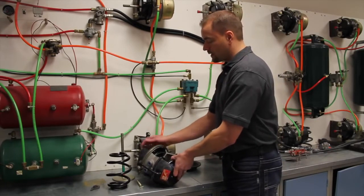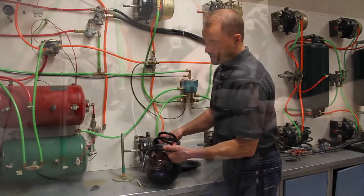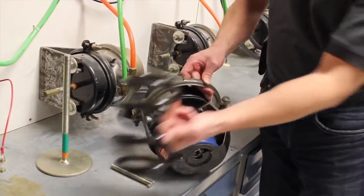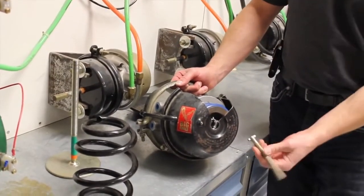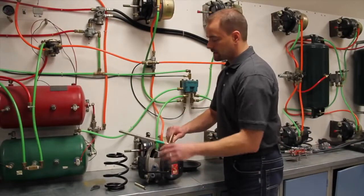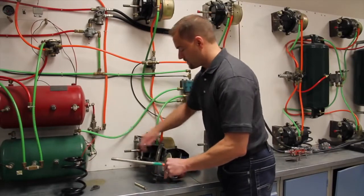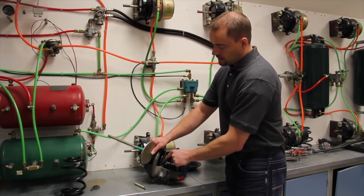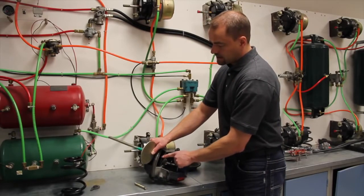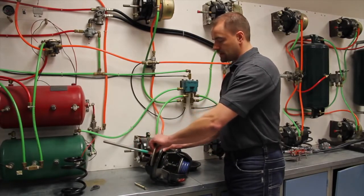What we're going to do here is talk about the spring. This is the spring I have here — as you can see, that gets compressed a fair bit. We're going to talk about how to cage a brake. This is just a cutaway we have, so this would be sitting inside the pot. You have the diaphragm here — air pressure comes in, you get the diaphragm, it pushes on the piston. You apply the brakes, that goes out. Brake's released, that comes back in.